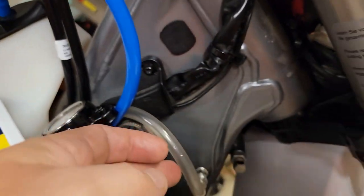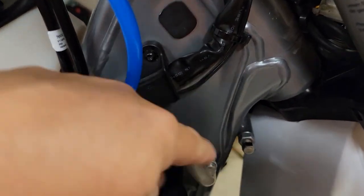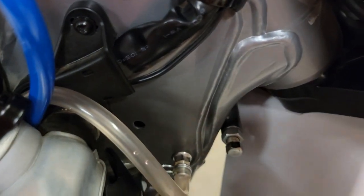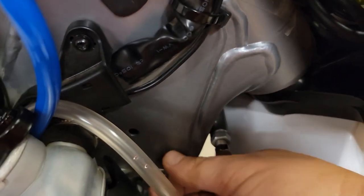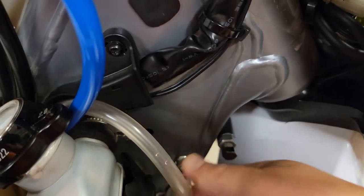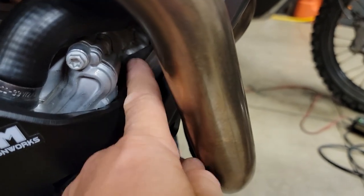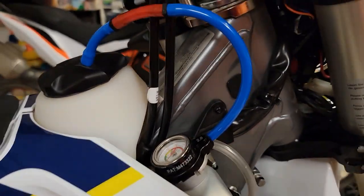It comes with tubing and you take your tubing from this right side, screw in the same little nipple — go easy because there's an O-ring and it's threading into plastic, so go easy when you tighten these in. You screw that in there, put a tube on, and I just came up and over the radiator and brought that down here so it can overflow once your canister is full. You could do it a different way — you could plug it into the factory one up in there that lets it spew down the side of your frame.